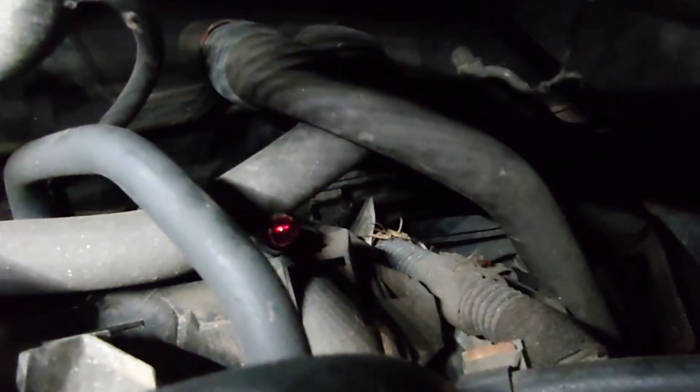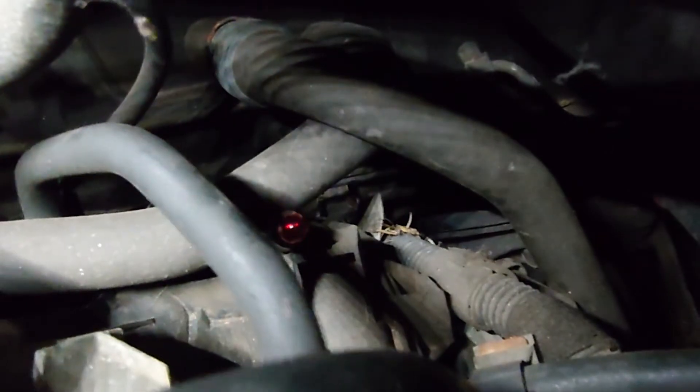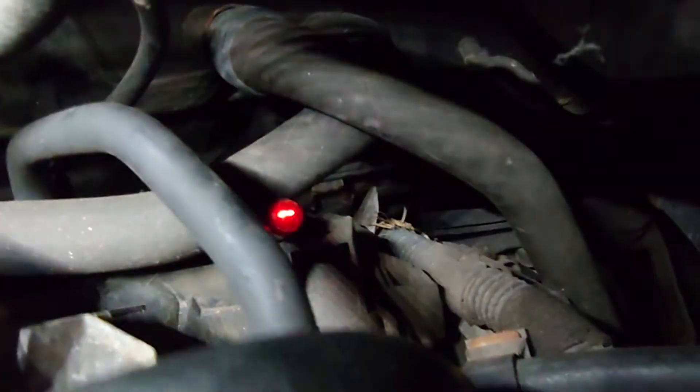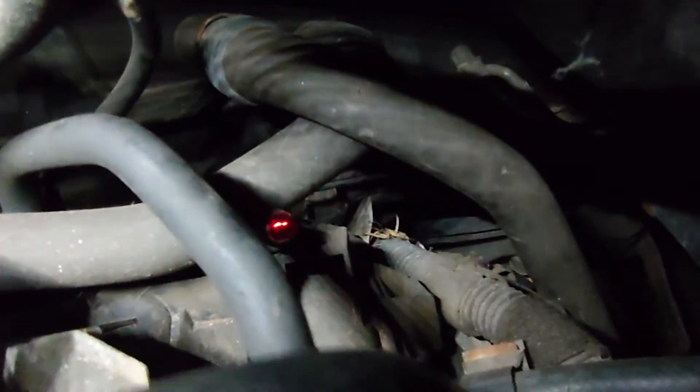You can see that cycling on and off of the heater, so we know that we've got a good voltage supply. It's a nice bright light — it will carry some current. There's that misfire. So we definitely know that is going to need an O2 sensor in the rear.